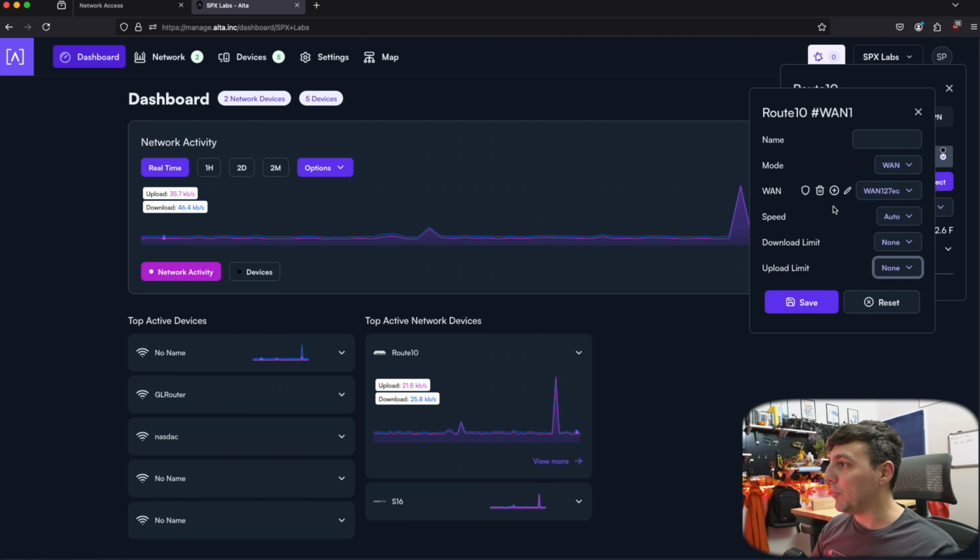We set a lease time. We could specify DNS servers. So if you wanted to use like 8.8.8.8 or 9.9.9.9 or whatever, 1.1.2.2. I mean, there's tons of options. We could do that. It looks like the default's 1.1.1.1 or 8.8.8.8. Those are good choices. Domain name, network domain name. Leave blank for a local domain. So I guess if we had a domain, we could set that.